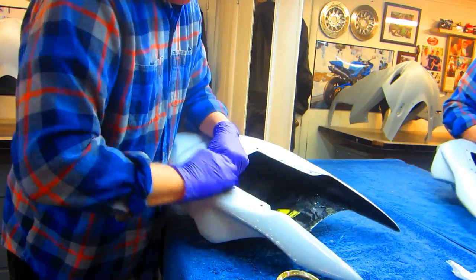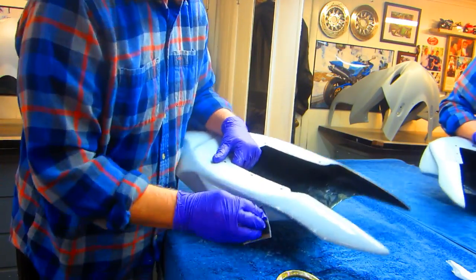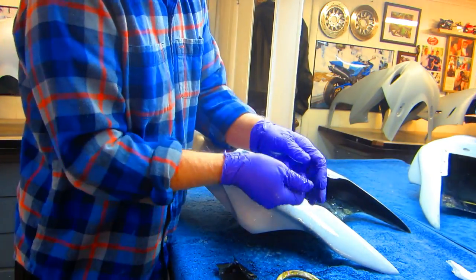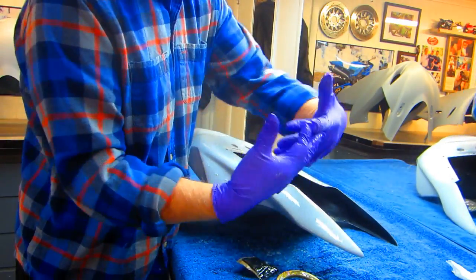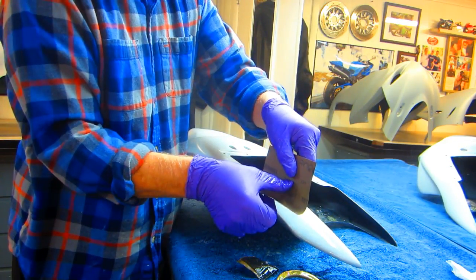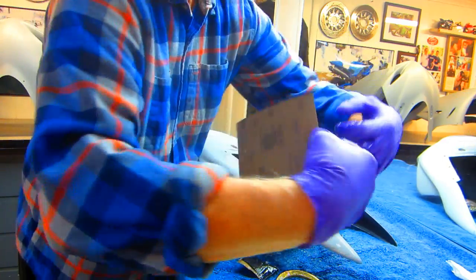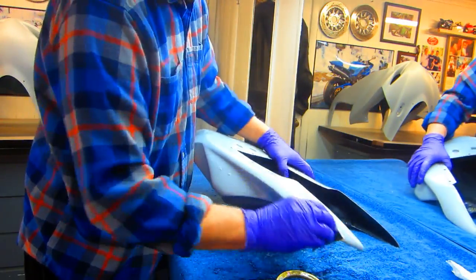And even the other night, just to make sure I haven't missed the boat on anything, I looked at a bunch of videos on YouTube that showed they're going to put a glue gun on and pull a dent. You're not pulling that dent out with a glue gun. On a fender, let me just show this, where you have a dent and it goes clunk, you put a toilet plunger on and pull it out. Yeah. But when a dent is where you've crushed the material in, you're not pulling that out. Sorry, YouTube. That ain't happening.